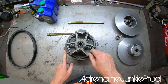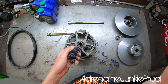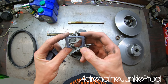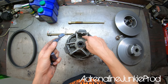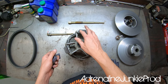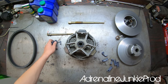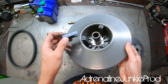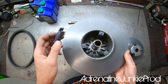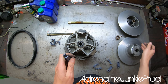The only thing I'll keep from Boondocker is the stainless steel super sliders in the primary. The secondary wear components are like a hard fiber-reinforced plastic and we'll replace all three. The factory sliders are made of tin and wear through; the Boondocker stainless ones still look good after a season. Once you see grooves worn through the secondary pucks, it's time to replace them.